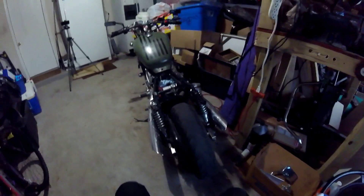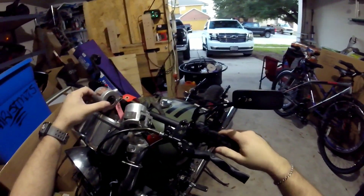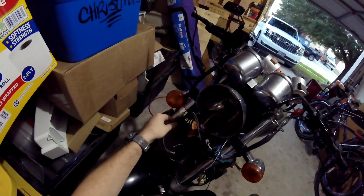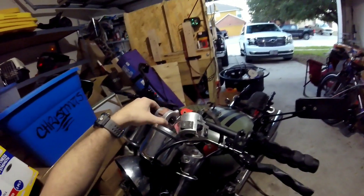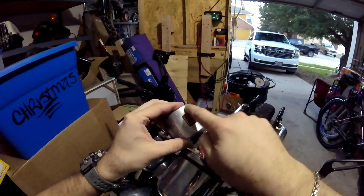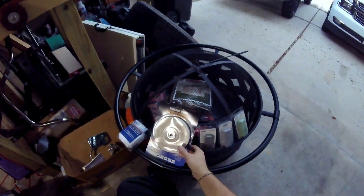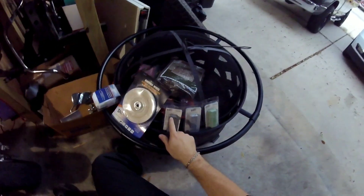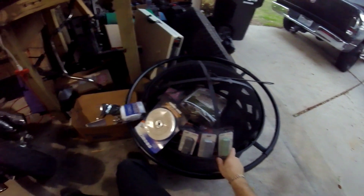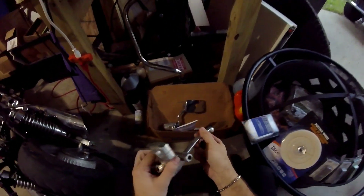Before I get started, I did buy some new parts for the bike. I had to go buy some new controls because this cluster just was not working. I got tired of jacking with it and I'm going to go back to the original. You can see how this is really shiny right here, but on the top it looks really cloudy. I went to Ace Hardware and bought a buffing wheel to hook up to my grinder, and with three stages of compound to polish I can hopefully get these to shine up a smidge before I reinstall them.